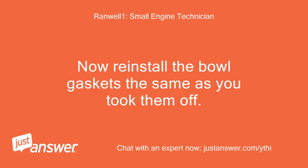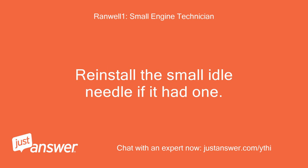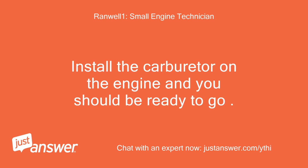Now reinstall the bowl gaskets the same as you took them off. Then install the bowl nut with the small gasket under it. Reinstall the small idle needle if it had one. There, you are done. Install the carburetor on the engine and you should be ready to go.